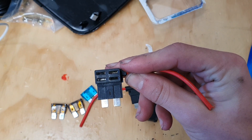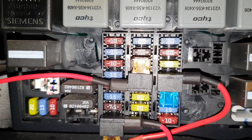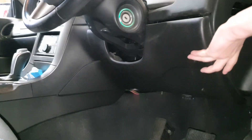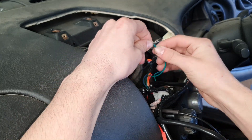Here's where I made a mistake of not checking every part — I got normal fuse taps but my car uses mini fuses, so I had to swap them out. With that done, I attached them into their spot and fed the wires into the dash, then connected the sensor wires together with solder and heat shrink.